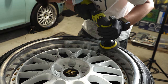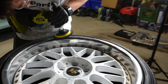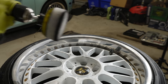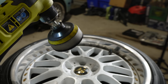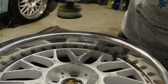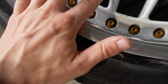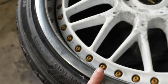So we finished with the wool pad. Now we're going to go with the white pad and continue polishing — I already put down some polishing compound, pad is on, ready to go. After doing the wool pad and the other polishing pad, this is where we're at: no more curb rash. It's not perfect but it's almost a mirror, so I'm going to hit it with this pad one more time and then try another pad and go from there.